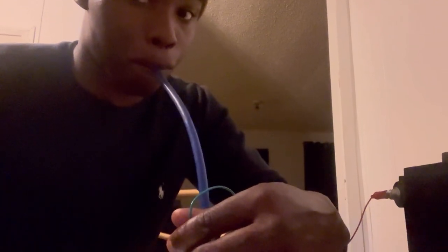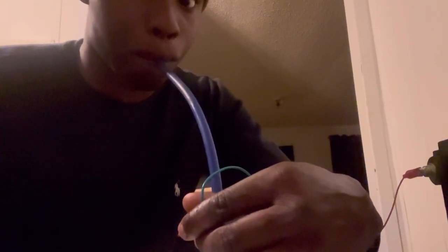This solenoid right here — I'm blowing so hard my head is about to explode, and y'all do not hear anything coming through. I tested another solenoid right next to it using the same vacuum line straw, and listen to that — you can clearly hear air flowing through. That is a major, major difference. So we may have — we do have — a bad TCC solenoid. We ohmed it out, yes it clicks, but is it actually opening all the way like it's supposed to? No, it's not. I think we solved our issue today.